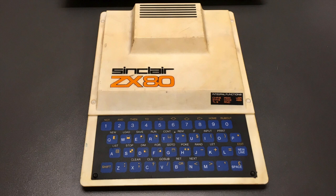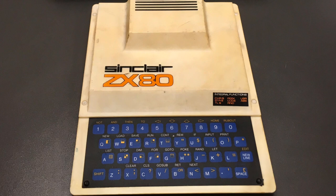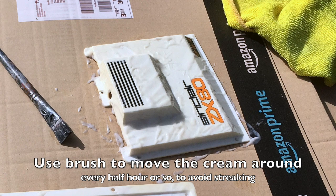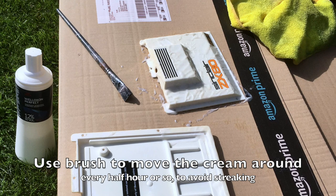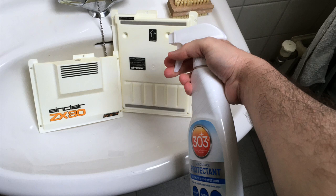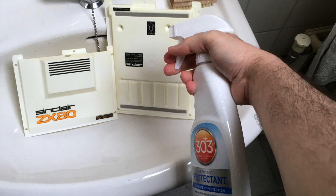I washed the case in warm water and soap quite thoroughly. The case was still yellow, so I did the mild retro brightening with 12% peroxide cream that you can buy on Amazon. I did it for about six hours in an afternoon — just used a paintbrush and put the cream around the case, and every half hour I'd go and refresh it a little. No need for plastics bags or anything; if you put enough it will not evaporate. It worked very nicely and removed basically all the yellow — there's only a hint if you pay attention.